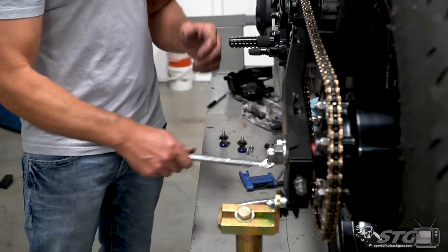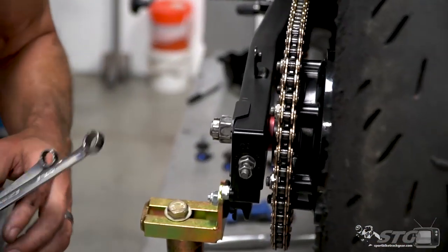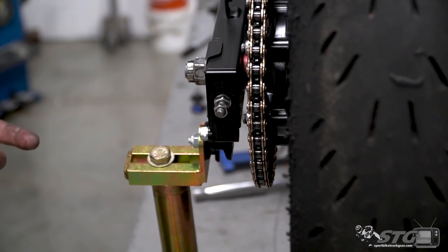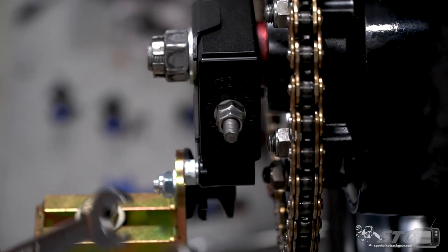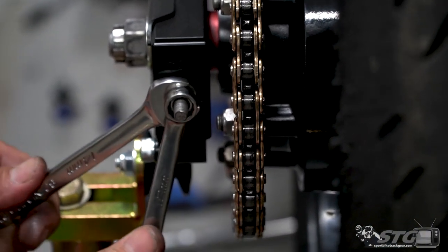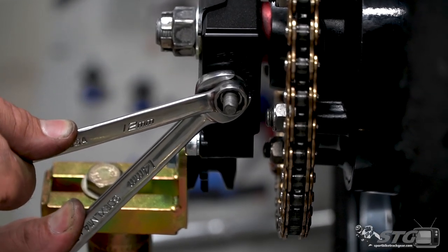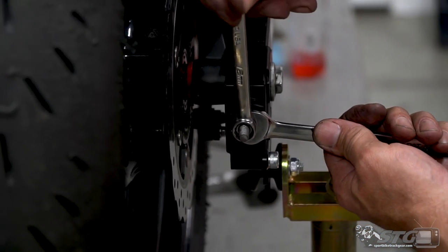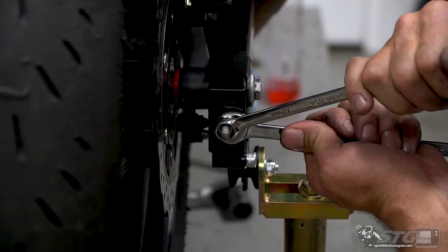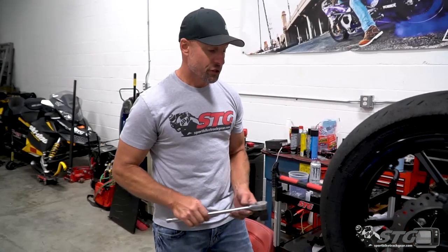I put something in between the sprocket and the chain, hit it a little bit while the axle was loose, then torqued down the jam nuts, then pulled everything flush against the swing arm. The rear fasteners were a little loose when I did that, so I torqued the axle a little bit, then removed the fasteners, installed thread locker, and put final torque — it's very important that you do that when these are flush against the back of the swing arm. I set the chain slack and rear axle alignment using a combination of tools: I like to take a measurement using the Motion Pro slack setter and Motion Pro chain alignment tool on the rear sprocket to get a good sight line on how the rear axle is aligned.